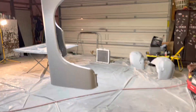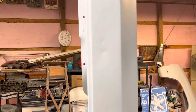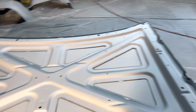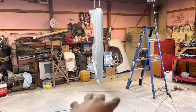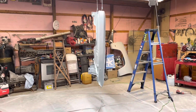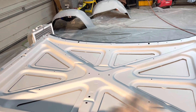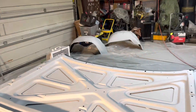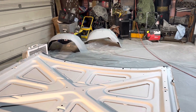It didn't turn out too bad. A couple spots that I should have probably got better, but I was having some paint problems with the gun. This should be good enough for now. There's a high there — that's all stuff that's going to have to get figured out. There's a couple dents right there, a couple dents on that one too. This came out pretty good for what it is. What I'm going to do for the fenders is actually put them on the truck to block sand them, so I'm just going to set those over there for now. Finish up messing with all this stuff, sand it up, get it ready for paint — those will probably get painted after all this because we gotta take the truck apart to put those fenders on.